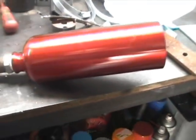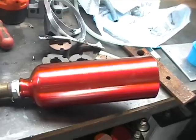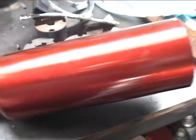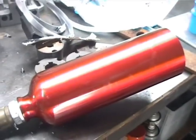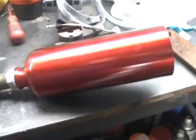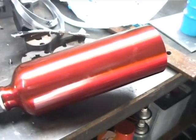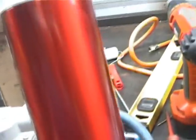As well as that, we have this guy here, which is essentially an aluminium sports drink bottle. The purpose of this is to provide a source of vacuum in the event that the pump fails. It will give about two to three applications of the brake with servo assistance. This is a good cheap option — it's quite light and it seems to be able to hold the vacuum.